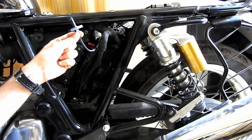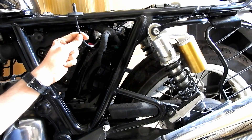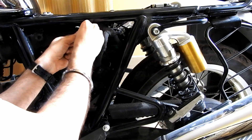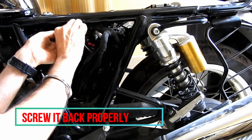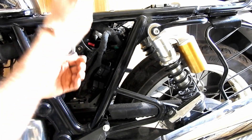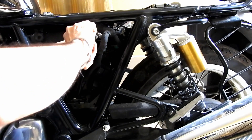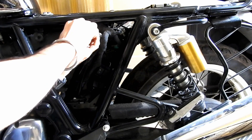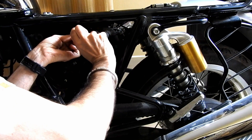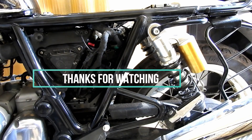Sometimes it is a throttle body stepper motor issue or a clogged injector. So this is a very basic, simple thing — if this little sensor is clogged, you might face some issues. To put it back, simply place it back and screw it in with the 4mm Allen key. Make sure to screw it in properly so it won't pop out due to pressure inside. Thanks guys and thanks for watching. Someone asked me about the location of this sensor on a motorcycle, so I thought of making this video. I hope it helps you and clears some doubts about this sensor and how it works.